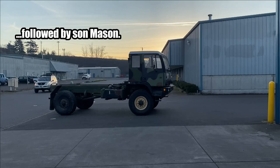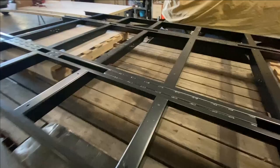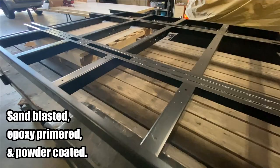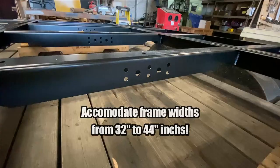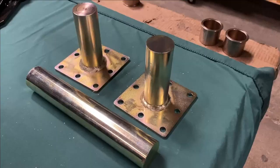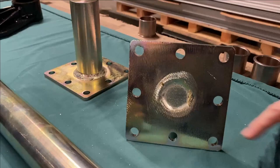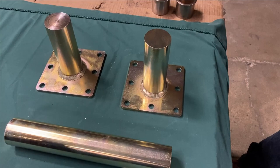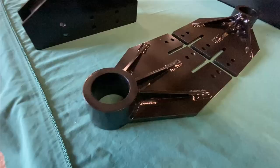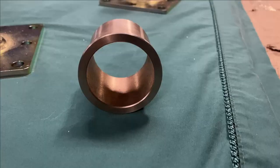So this is the subframe, and this is how it comes shipped with all of these weldments in place — it is completely powder coated. One of the many great things about this system is that it is totally customizable. These are two-inch diameter chromoly steel pegs. They have a shear strength of around 120,000 pounds. What we have here is zinc-plated for your protection against corrosion. When we design these parts, we also have the shaft come through the plate, so there's actually no load balance or shear factor on the actual weld itself — the weld is just there to merely hold the shaft clear, parallel and square. I was just amazed at the wonderful quality of the parts — they were just awesome. All of these parts of course would come pre-assembled to the customer.